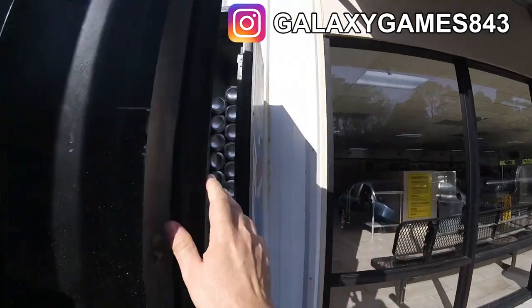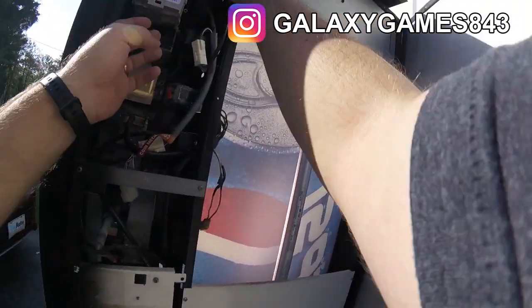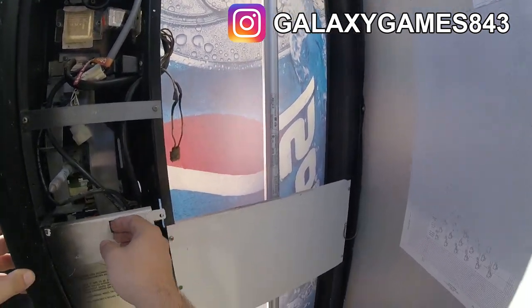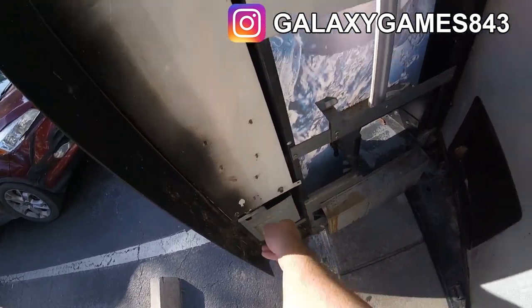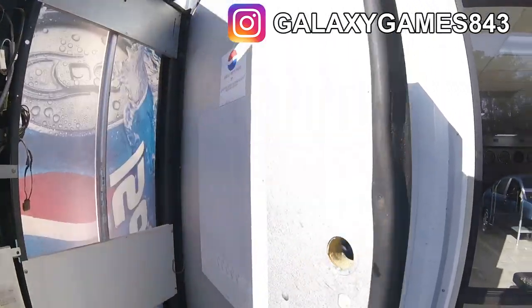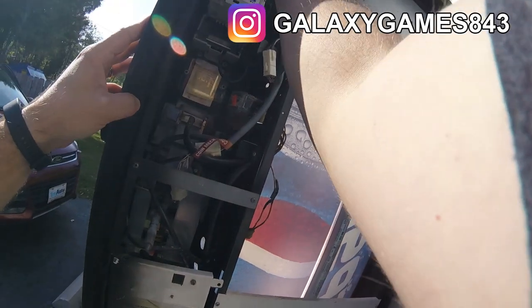The yellow or green lights are not flashing on the dollar bill acceptor. Right off the bat I got to check some things out — there's no red light on the back, which usually means there's a problem with the coin mechanism, or the coin mechanism is not activating that dollar bill acceptor. We're gonna start to run some tests. The stock levels seem pretty much the same, so this machine has probably been down for a little while.